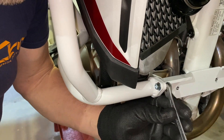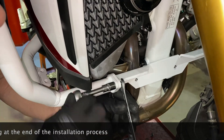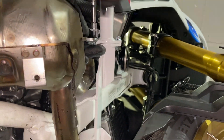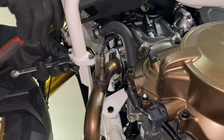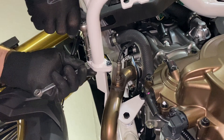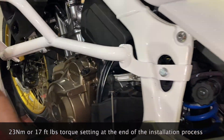You can tighten the bolts on the front end. After tightening all M6 bolts, you can torque them to 9.7 Nm or 7.15 ft-lb. Then move over to the left side and repeat the same steps using a 10mm wrench or spanner and a 10mm socket with extension and ratchet. Once done, apply the same torque specs. You can then fully tighten and torque the back plate — the specs are 23 Nm or 17 ft-lb.